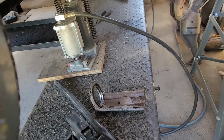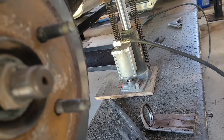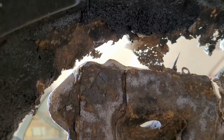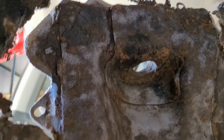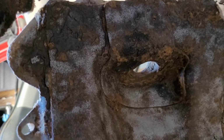I've got a design right here that I'm working on. That's what's left of a swing arm. I cut it and I took the bushing out of it. So what I'm going to do is weld it to the frame here, and then weld it to that and back that up. Then I'm going to have to get sheet metal and fill in these holes. What I'm going to do right now is run down to Wilbert's and look at a couple of Escapes and see if somebody's already made some repairs here. Cut their repair out and weld it to mine.